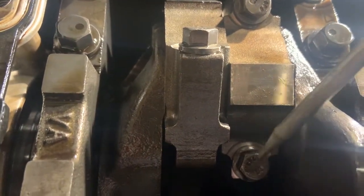I took the cap off that particular rod. This is the cap that was holding the rod in place around the journal. That shiny metal right here is the journal the rod is attached to — this is one that's intact; that's the rod, that's the piston. Inside this cap is a piece of metal — that's what I keep calling the bearing. This thing spun out because it wasn't getting enough oil. Those are actually oil galleys where oil is supposed to be flowing constantly, so the crankshaft journal really should never come in contact with this metal bearing — it should have a thin film of oil.